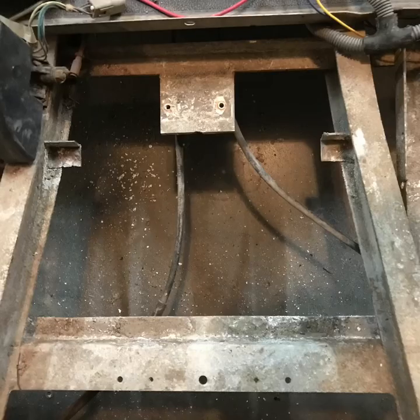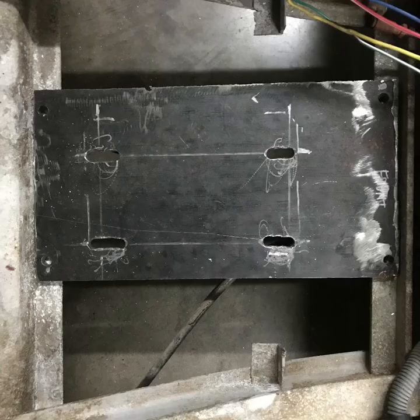Since you can't weld metal to the aluminum, I have to bolt everything in. I had to cut out where the batteries held up, and bolt in the motor plate. You can see where I cut out for the batteries and put my motor plate down in front of it. In all four corners there are holes — I have to drill the aluminum to bolt in my motor plate. My motor plate is three-eighths of an inch thick; it's heavy, and that's the way I wanted it.